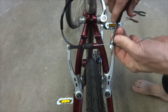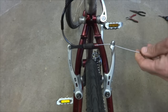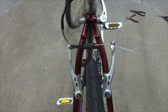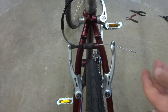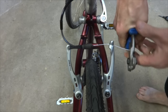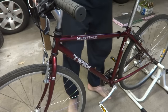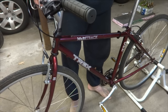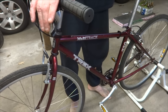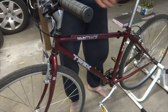I tighten down the screw all the way, cut the excess cable off, put a crimp on there, and clamp it in place. I tuck the cable back behind there to get it out of the way. I'm all done installing the V-brakes — that's how to convert from cantilevers to V-brakes. I'm not going to install the shifter cables in this video since I already have that in other videos — I'll post a link in the description.